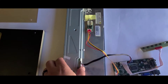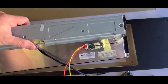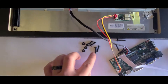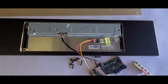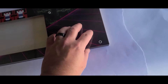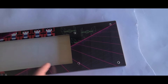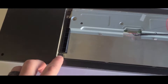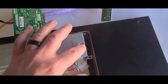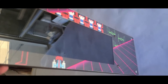You can see the holes are already in it — that's the top of the monitor. I have to peel that off the front, then it's just going to sit in there perfectly like that, and I'll use the bolts and nuts to secure it. I'll peel the paper off the plex and set the plex on top, then put the bolts through the plex and through the monitor and put the nuts on. You can see I got those four nuts on the back. Everything fits exactly how it should, and you can see how nice and seamless that looks from the front.